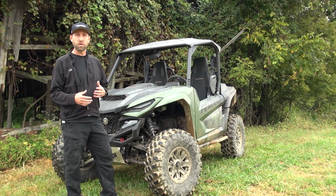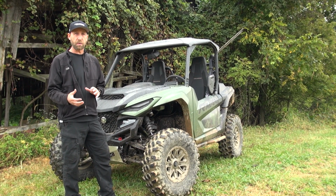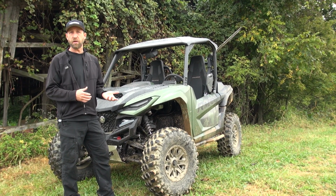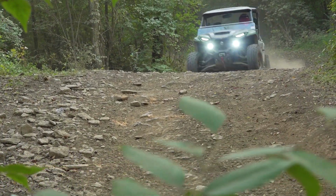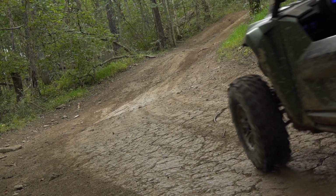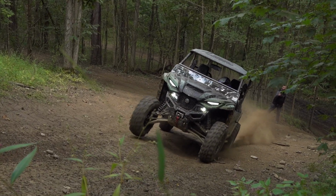On the East Coast here, we run a lot of position number 1 because it really is the softest and most comfortable setup. We lower our tire pressure, and again, we don't have an anti-rear sway bar. We do have one in the front. What we did there was on the front side, it really helps from a steering perspective. You really don't have to wait for the chassis to stop moving before the vehicle turns, and it gives you a really good confidence-inspiring feel from the front side.